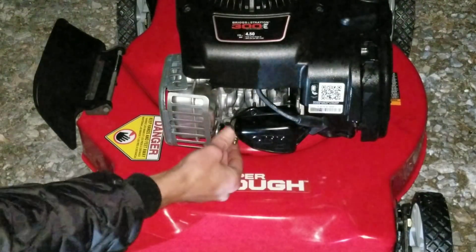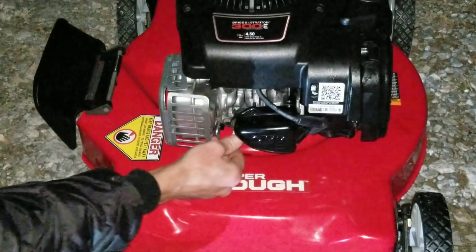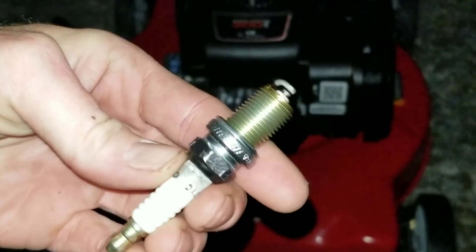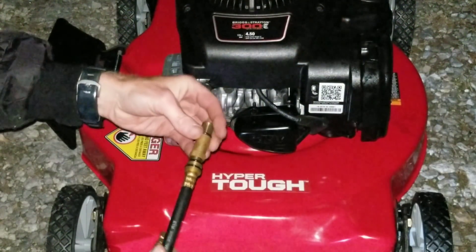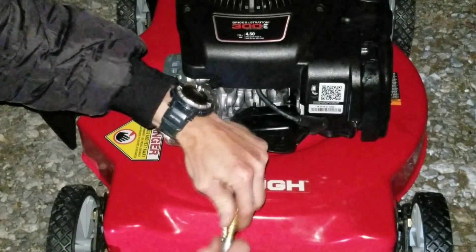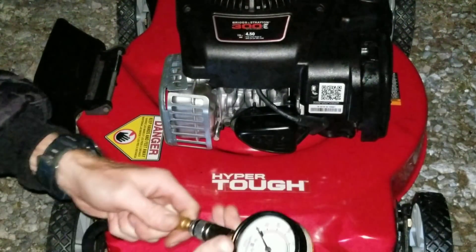Break that loose there. It's already getting cold — that time of year. Let's go ahead and check out the spark plug first. As you can see, we have the spark plug and it looks perfectly clean. So far, so good. Let's go ahead and get this hooked up for our compression test. I found one that fits well — let's hook up our compression gauge. This will come in very handy later on because we're going to find out what actually works and does Seafoam actually lubricate.